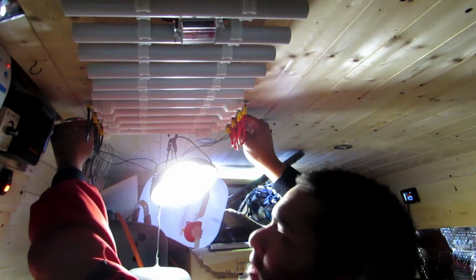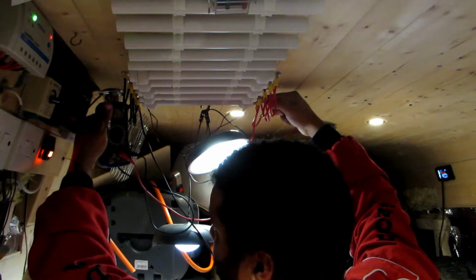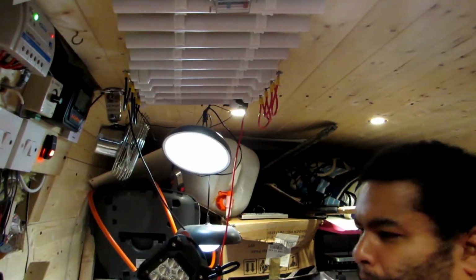My plan was to set up everything like the alternator, my solar, my windmill, all at once on the power wall. But the reason I can't really do that, I have to change the whole 12 volt system in my van, because my solar controller is for acid batteries, and the way I set up my 12 volt, everything is controlled by my MT50 and my solar controller. So I made basically an earth block, and then I've got a fuse box, and my load powers up all the remaining. That makes sense, if you understand what I'm saying there. So if I have my lithium power wall, I have to change all that, and then I have to put another controller and stuff like that. Obviously I'm buying a solar controller separate, but the way the lithium controller is to this controller is different because you don't have a load, so that's one of the reasons.